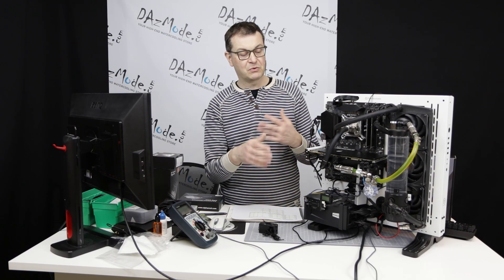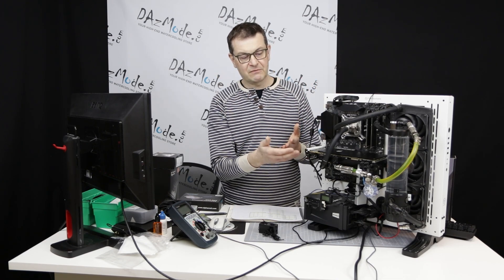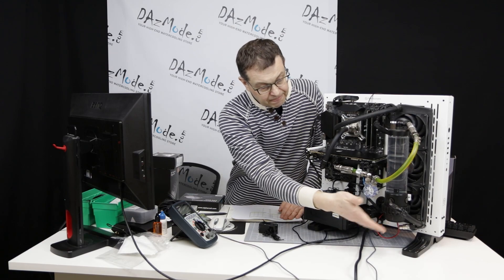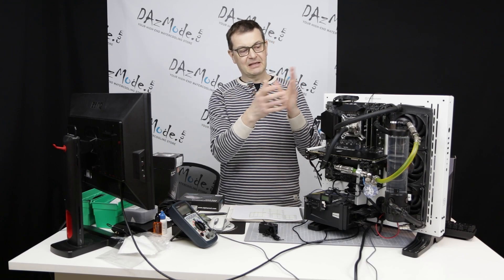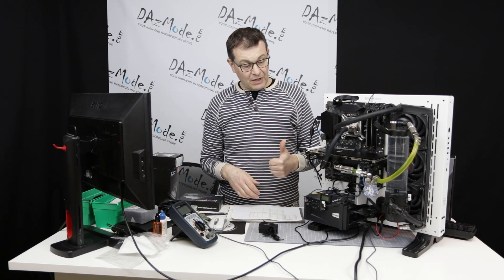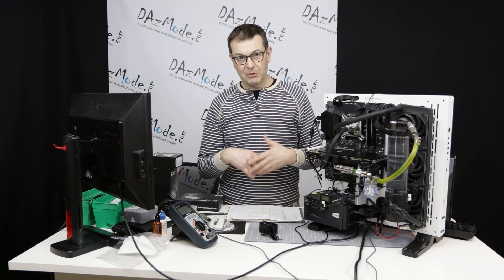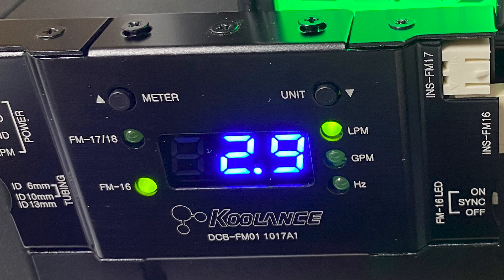The purpose of the GPU — I'm not going to benchmark it — but I wanted something to resemble the computers that most of you have at home. So you have a CPU block and a GPU block, which gives us the right restriction levels and some heat output. I put in a much cheaper reservoir and pump combo — it's still a D5 Barrow at maximum speed, but it's an assembled system from multiple brands that we sell under the Dark Side brand. Power supply stays the same; those are the only parts that migrated with the case.